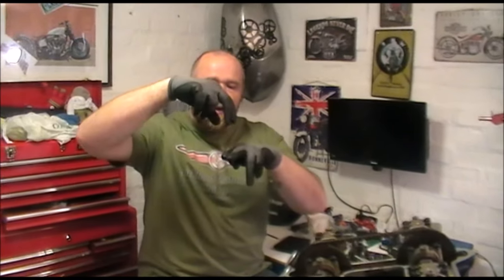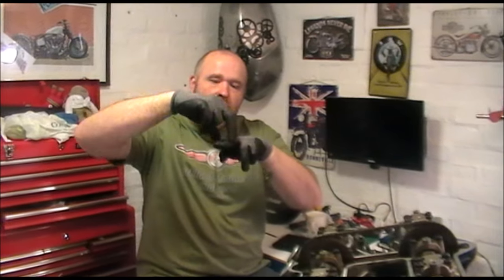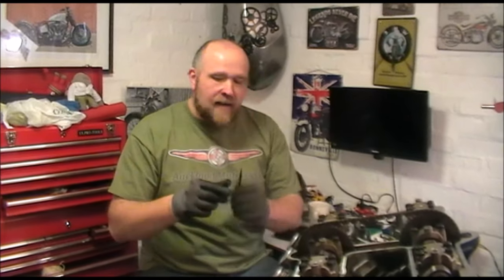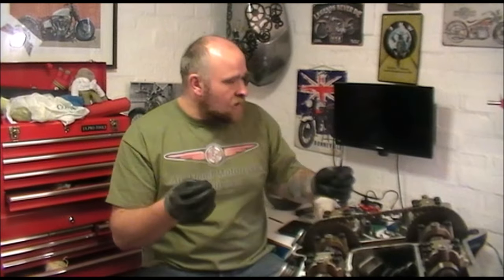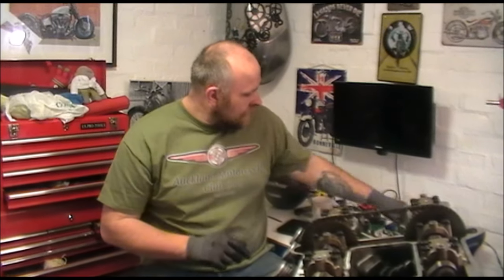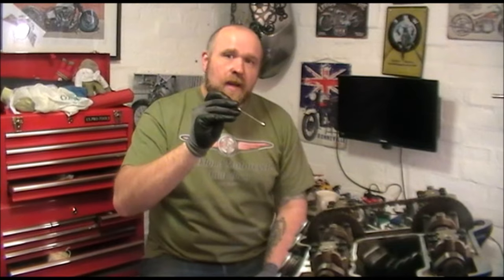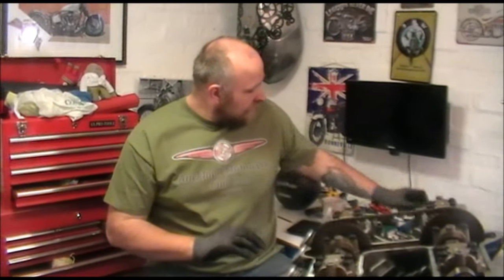The second tool you're going to need is a very blunt, thin screwdriver. The shims sit on top of a bucket, and that bucket creates a vacuum — you'll need that to prise the shim off the bucket. It needs to be blunt because you don't want to score the shims in any way. You may also need a magnet — the manual recommends it — and that's one of the easiest ways to get hold of the shim and pull it out safely.